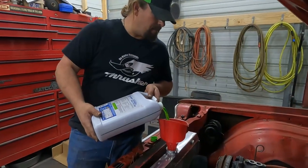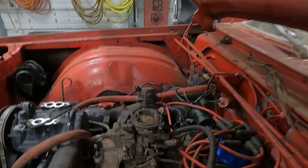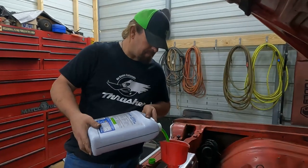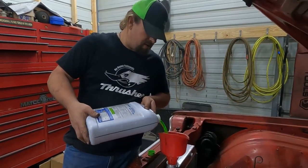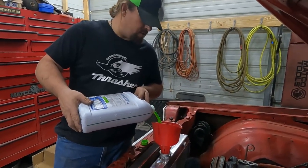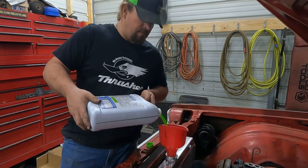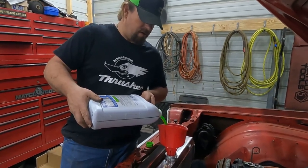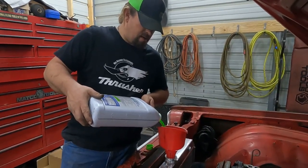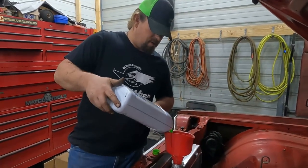We've got our coil mounted and the wire is hooked up correctly. We've got all of our radiator hoses on. We've got our heater hoses looped. We've got our power steering hose looped, because going to the newer style power steering pump means that the pump takes an O-ring fitting and the power steering box does not. The fittings I had would not work. The power steering pump that was on the car had a flare type fitting, or maybe, I don't remember what it was. Anyway, I didn't even try, because I knew it wasn't gonna work.